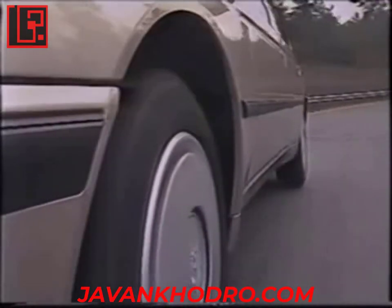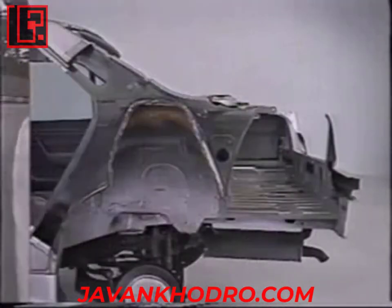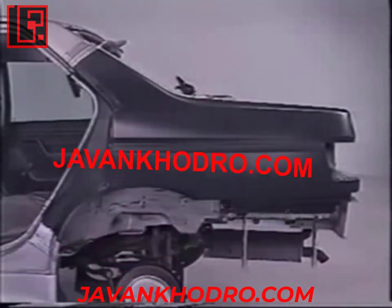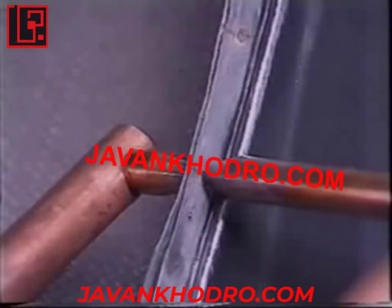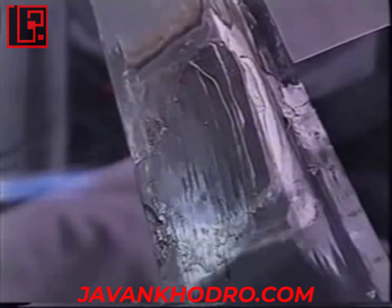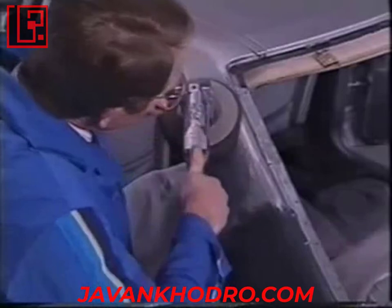The rear left-hand wing has been replaced by the sheet metal workshop on a Futura Grey 605 type car with varnished metallic finish. Various welding processes have been used. A tin glaze has been applied at the rear quarter seam. Several areas have been sanded.